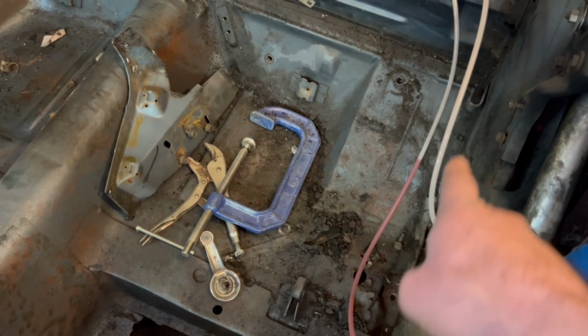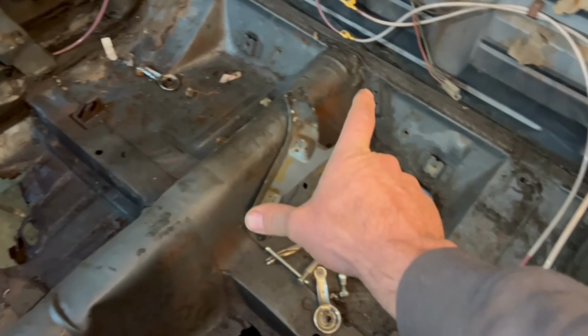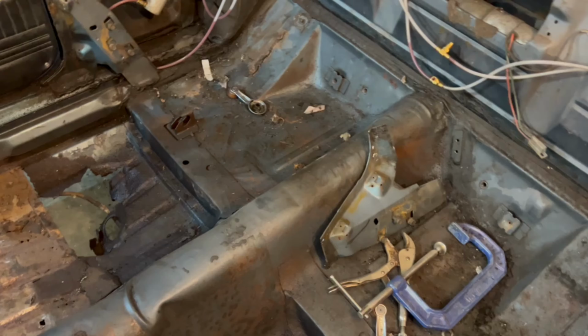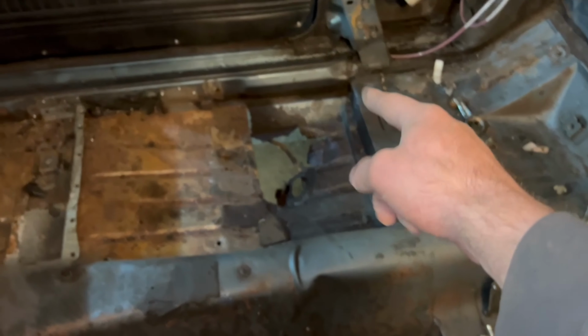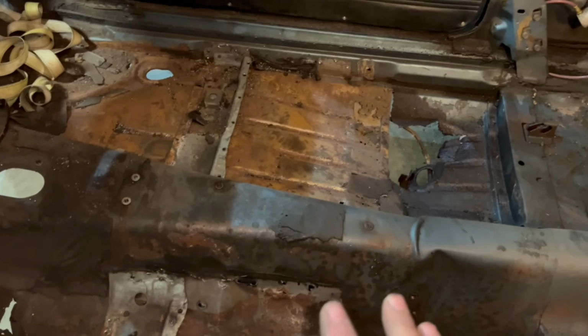And the other thing is, since I don't have, go check us out, a big old gap here, should be a driver's side rocker panel. I don't want to cut this apart yet, so I will not be removing the rear section of the floor pan today, because I still want to leave some of the car tied together until I get that rocker panel put back in. But like I said, time is gold. We've got to use it wisely, so I'm going to get something done. This has to come out anyway, and I feel I can get this out without compromising what I have going on here. So I guess I'll probably just cut it straight across through here, come across the rocker panel, but that's what I'm going to work on here today.